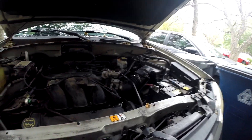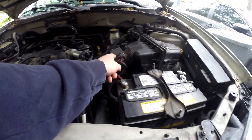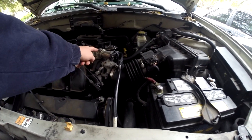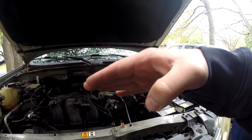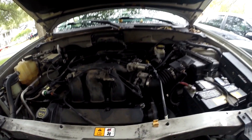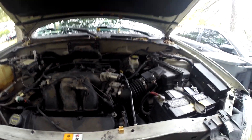Today we're going to be working on a 2003 Mazda Tribute ES V6. We're going to be cleaning the mass airflow sensor, throttle body, and the idle air control — IAC. I've been having idle issues where, especially when you're stopped, it'll just kind of stumble. That's one of the probable causes, and it's one of the easier things to do, so I'm going to show you me doing that.